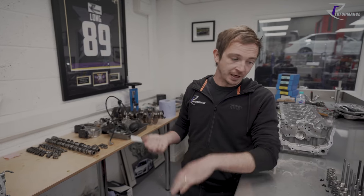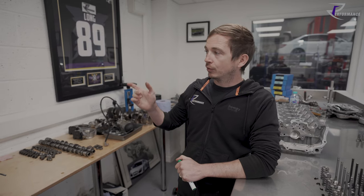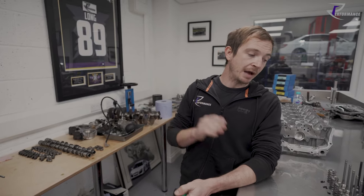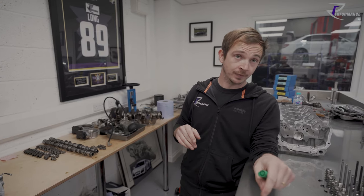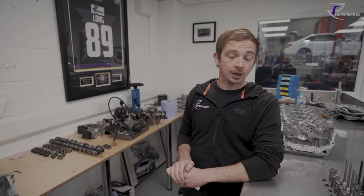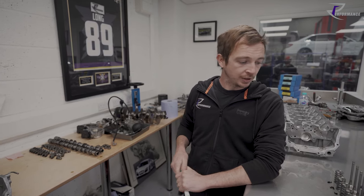So different engines require different valve train. We've gone this way because when we turbo it, we're not using more RPM, we use less RPM, but we're having to battle, especially as we're putting boost in. So your inlet valve's now not fighting atmospheric pressure, it's fighting boost pressure to close. And your exhaust manifold pressure, the logging we've got on that at the MoTeC, because we log that, it's pretty scary.